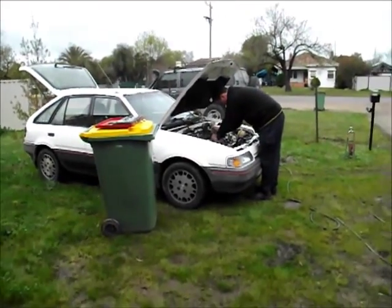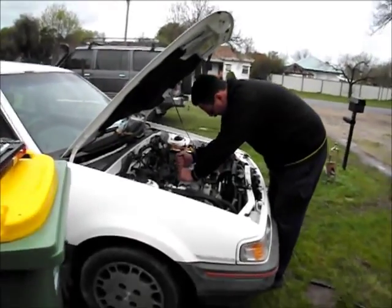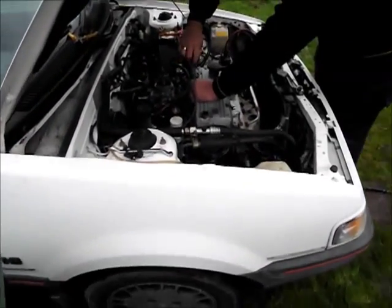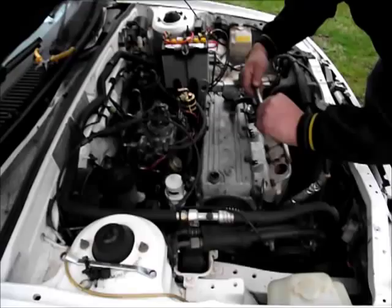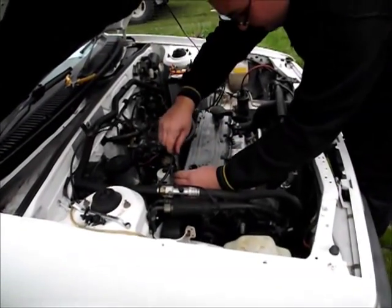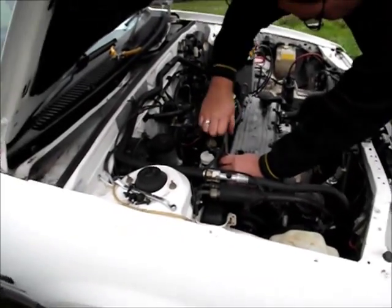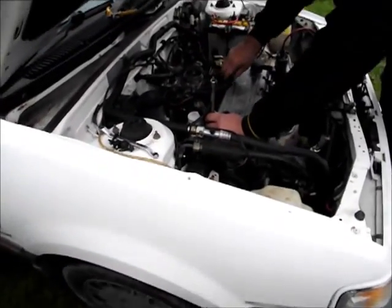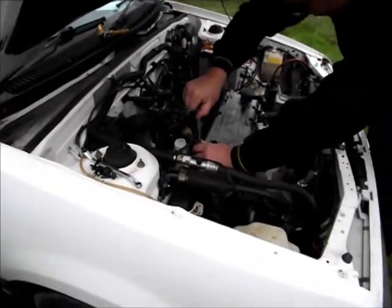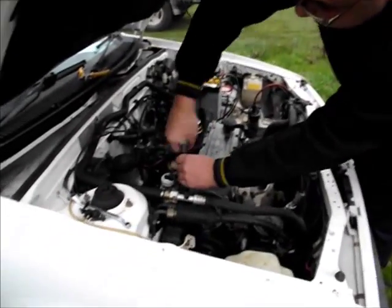Well good day everyone. I've got my mate who's head down and ass up working on a car. This is the Ford Laser — the one that was smokey for the first three minutes of running, and the smoke cleared. But it's got almost a dead miss in number 2 cylinder. According to the vacuum gauge, the twitching needle is telling me it's got a valve problem. I think it might also have other problems, but I'm not going to know until we get it apart.